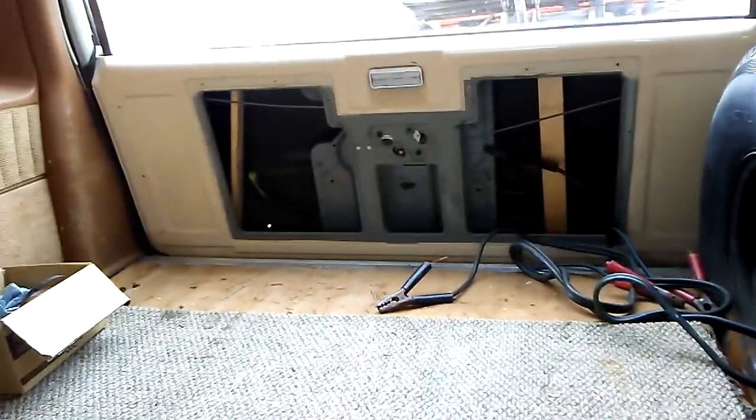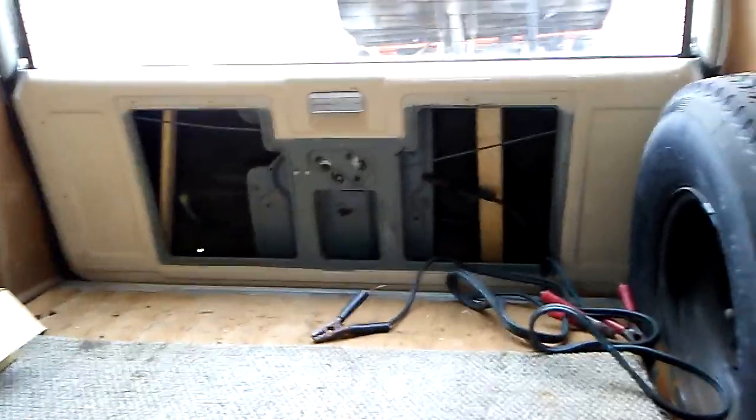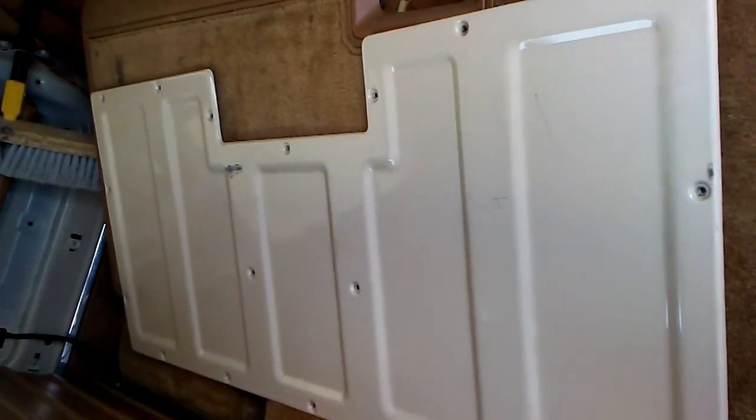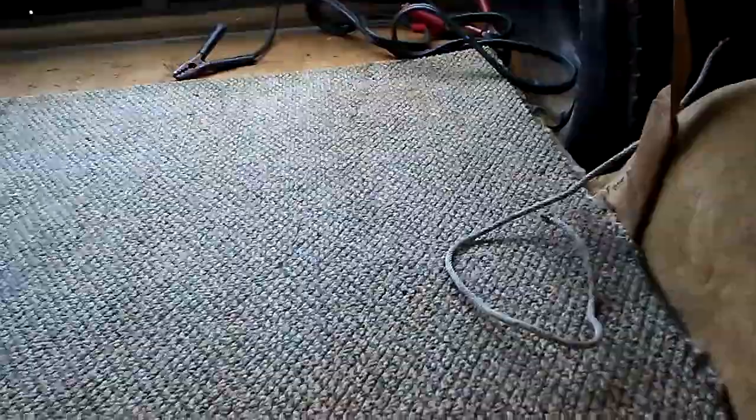This is the inside and the regulator has already been removed. You're going to need to take off the outer cover — you can see it right here — and then the inner panel, which is probably 25 screws to get it off. Those come off first. This one just kind of hooks on the top. You take the screws out and then lift it off.